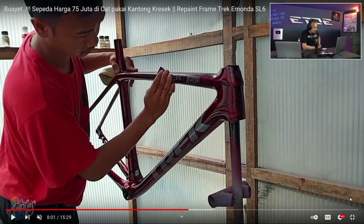Yeah, wet sanding of the clear coat gives a high quality, and sanding these decals is necessary because there's a gap in between these decals. So if you apply a two-color decal like he did, black and silver, or this effect color, you have to sand it flat. You have to flatten the gap in between the decal and the frame color, and that is what he did.